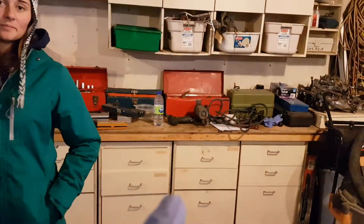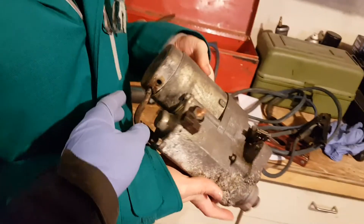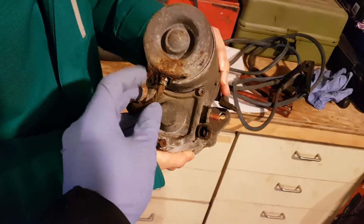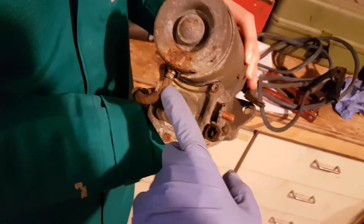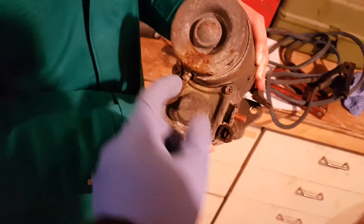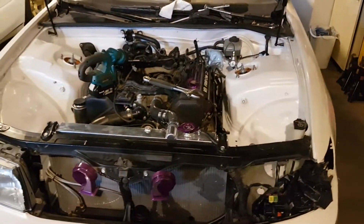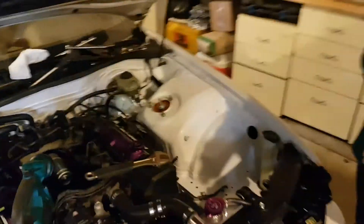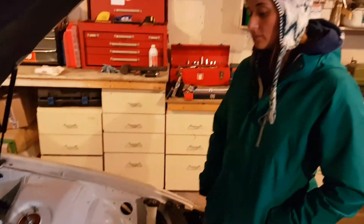There's the old starter on the bench. It was kind of unmotivating because when we bench tested it using a battery, it fired up perfectly fine. But then we saw this wire going from the main power to the stator on the motor — the protective shielding has come off. I think when it bolts to the motor, this makes it grounded, so the starter just cannot disperse the current well enough. And the 1UZ is a terrible motor for this because the starter is located right under the intake manifold.